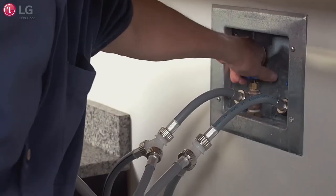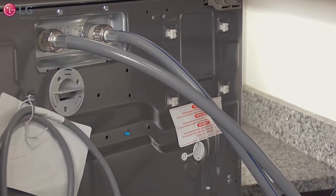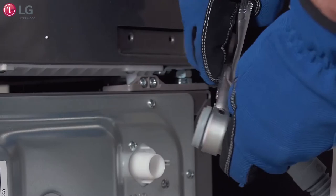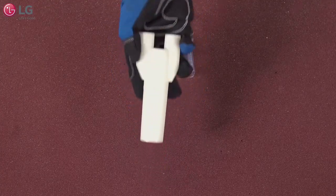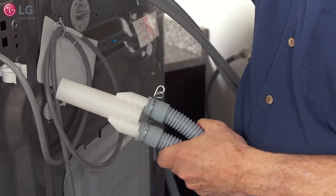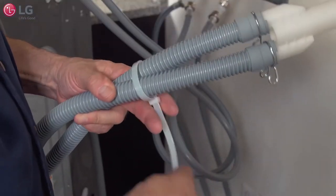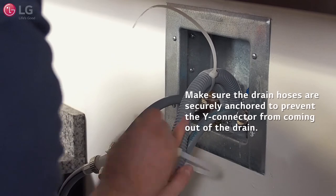Turn on the water and check the water faucet connections, main washer water inlet valve connections, and Sidekick inlet valve connections for any leaking. Install the Sidekick drain hose using the bigger clamp, making sure the drain hose elbow is pointing toward the ceiling. Connect the main washer machine and Sidekick drain hoses to the big drain Y connector with a clamp on each hose. Failure to use the clamps could result in flooding if the hoses come loose from the Y connector. Use a tie strap around the hoses and insert the drain hose Y connector into the drain, then use another tie strap around the bundle of hoses to keep them together.